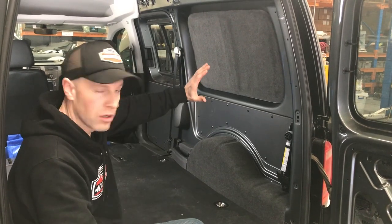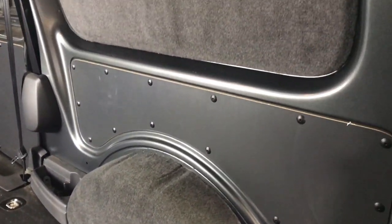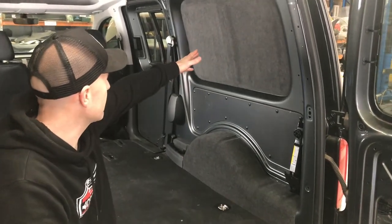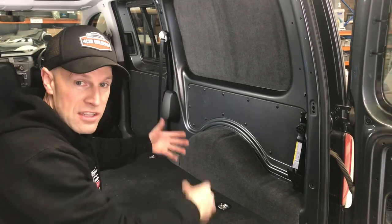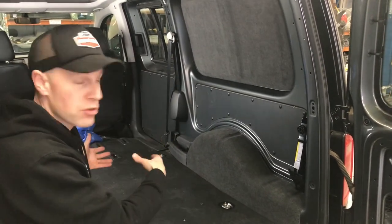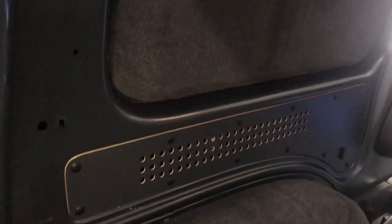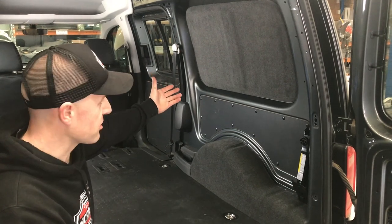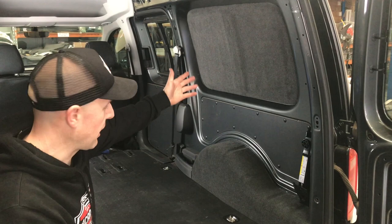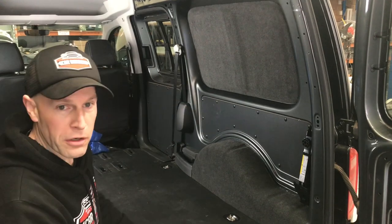You can see inside now — we've got our finished carpet. On the wheel arches we had our sound deadener, so the dampening is good, and then we've used our stretch carpet to cover it over. It's fairly forgiving — you get a fair bit of stretch out of it. The rear window panel has our foam and our dampening sheets on it. Having a textile face in here is going to help with inbound sound — whether you're talking or playing music, it'll absorb sound rather than bounce and echo around the car. The colour fits well — that's our mid-grey, and we also have a lighter version and a black. We used just over a box of stage one sound deadener, two metres of van liner, and a couple of metres of carpet. All this took us around four hours to do, and it's something very easy and achievable for most people.